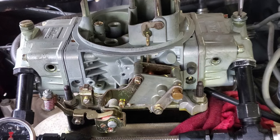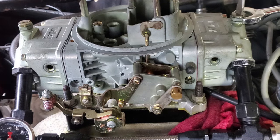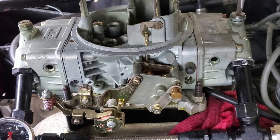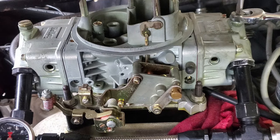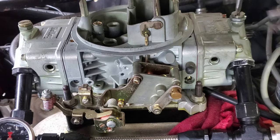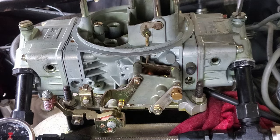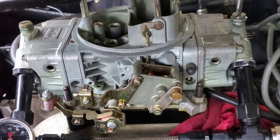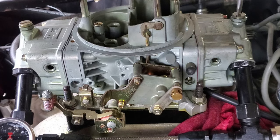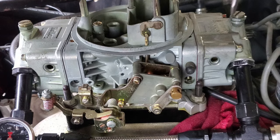I'll rock the car to get some of that gas out. It's still coming out, so I'm going to loosen the retaining screw a little more and crank down on the nut some more. I tightened up the retaining bolt on top and I'm going to rock the car to start fresh. Let's get that gas out of there — that should be good enough.